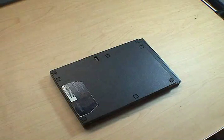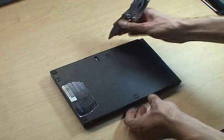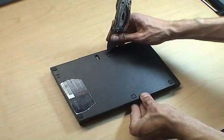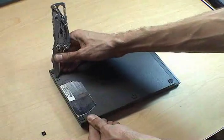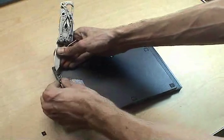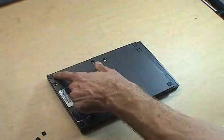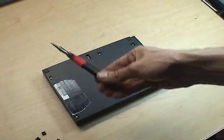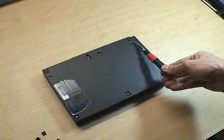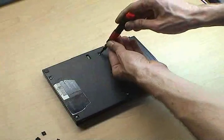Your first task is to open the machine. Luckily, the slim PlayStation 2 is a lot easier to work on than the original fat model. The first step is to remove the plastic screw covers, which can be done with a small screwdriver — or I prefer to use a pocket knife. Just don't stab yourself. The two front feet are just rubber feet adhered to the casing; there are no screws under those, so don't bother peeling them off. Beneath the six screw covers are six Phillips-head screws, removable with a number one or preferably a number two Phillips-head screwdriver.